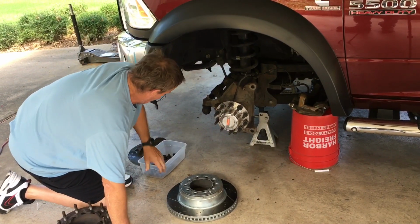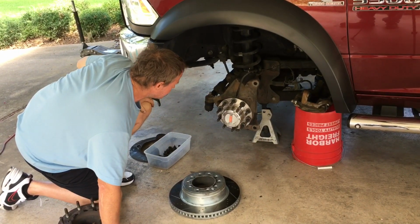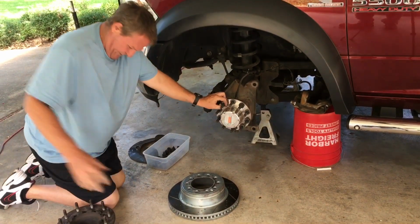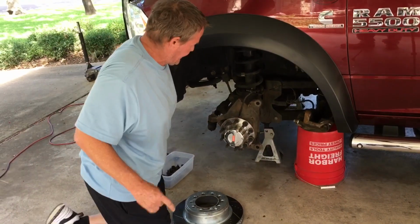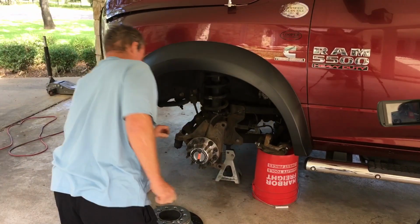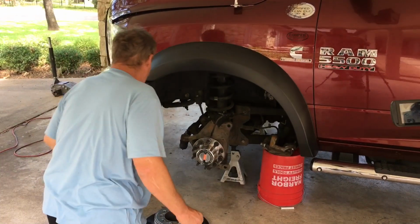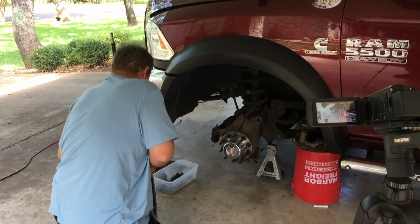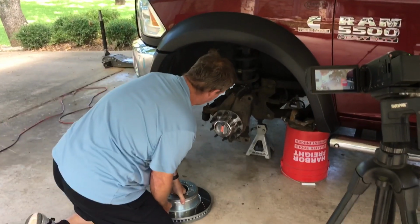If you've got a car that has 500 horsepower and can do the quarter mile in 10 seconds, to slow that same vehicle down in 10 seconds, you have to be able to absorb 500 horsepower in 10 seconds. But nobody stops in 10 seconds. They don't stop in 5 seconds. So at 5 seconds, you'd have to absorb 1,000 horsepower. And at 2.5 seconds, it's about 1,500. These rotors typically have to absorb about 500 or 1,000 horsepower at any certain time within 2 or 3 seconds.